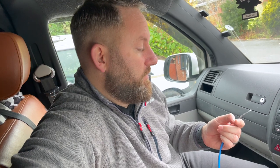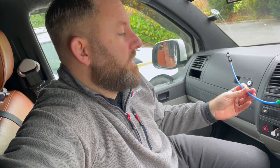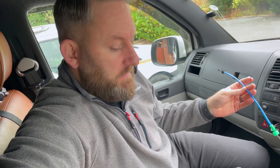Finally working. Right, so there you have it. Manufacturing fault on these. They don't know why they've used braided cable. It's knackered. You see the bend. And it's apparently a common fault on these. It's supposed to be a 10, 15 minute job. Whip in, whip out, get it changed over. But as usual, it takes me about 3 days to do stuff. But hopefully it's helped you out a bit, really, to see why your controls are not working and show somebody how you can just pop it off.